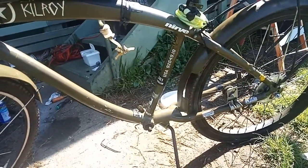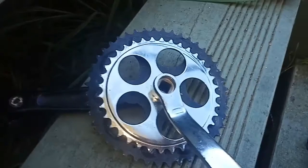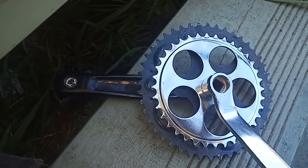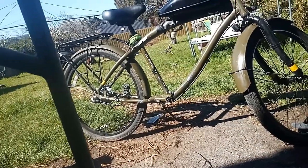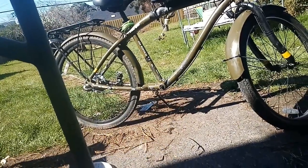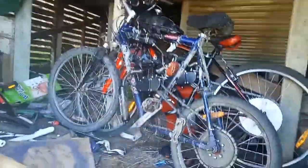The next step is to grab that crank set and start sticking it on the bike. Interesting to note that the chain ring I'm putting on is a fair sight smaller than the one that came off, which probably means I'll have to take a few links out of the chain - which is not a big deal, the chain was always a bit loose anyway. Removing links isn't too bad. At least the chain on this bike has its own master link, so I don't have to worry about using up all my spares like I had to on that other bike.